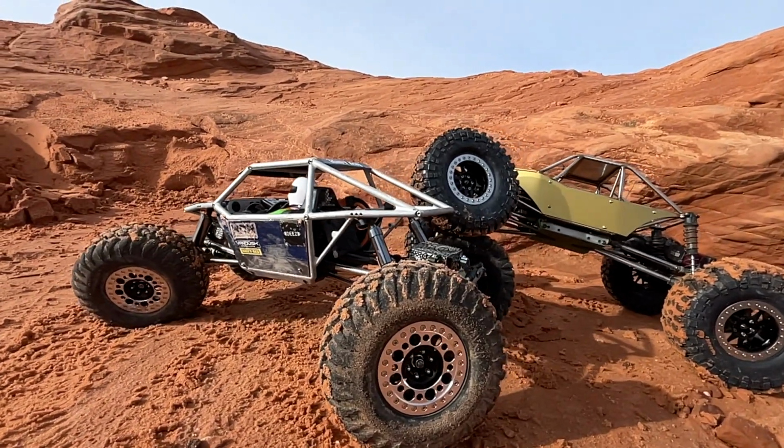All kidding aside, I did have a small issue getting the 3D printed flat skid to fit that I typically use in the regular Axial Capra build that I was running until converting it over to this kit. I had to take the upper link mount screws, the M3 screws that I use to mount the upper links, out and actually insert them from the inside of the skid to allow for just a few millimeters of extra clearance, and that's all it took to get the flat skid to fit into this tube chassis.